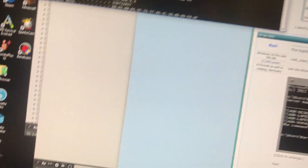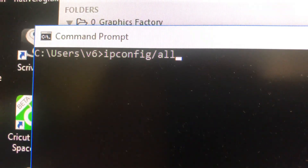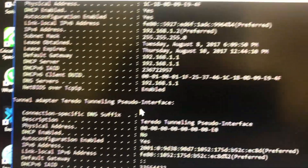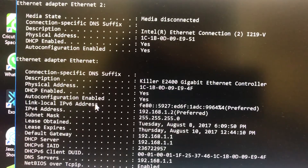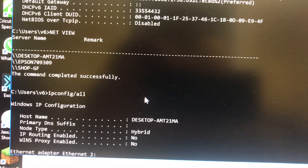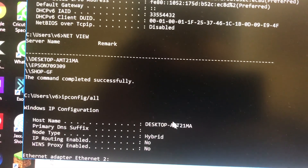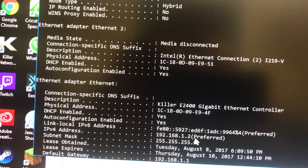If you're on Windows, you can use 'ipconfig /all' to find the IP address. This is going to give you a screen, and you're going to want to look at the IPv4 address on your network. You should see one for the Antminer — it'll say Antminer. Find the IPv4 address of this, type that into your browser, and you'll get to a page just like this.